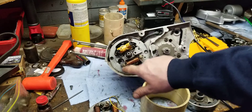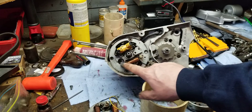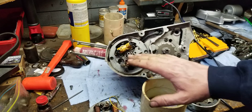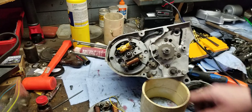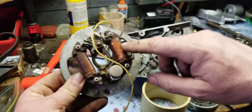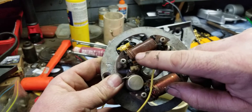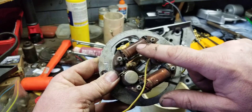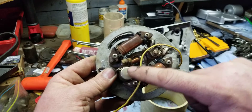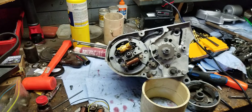So I was able to make that beveled edge on these two screws and use the factory screws. You can see there are no points, no wiring for the points — it's all ripped out. There are two charge coils in here: this one is for the lights, which is a completely separate circuit from your ignition, and then you have your ignition coil. The fine-wired coil is for the ignition system, and it runs from here through to your CDI ignition coil.